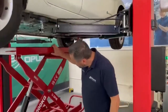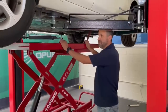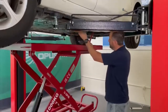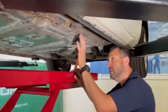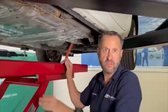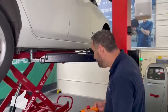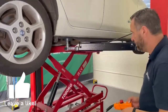This is our new battery lift — the Eurotech 1000kg lift, which has a slide-on so you can replace the battery. I've now undone the majority of the main bolts on the battery and I'm going to be lowering the battery down onto the lift, then lowering the whole assembly out of the vehicle. The battery pack is now fully undone, and the battery pack is going to drop out of the bottom.